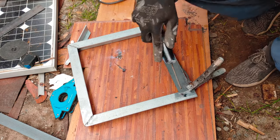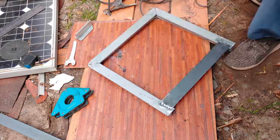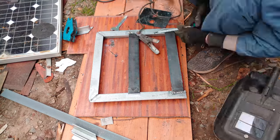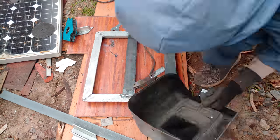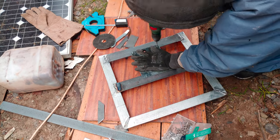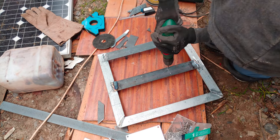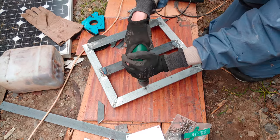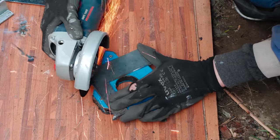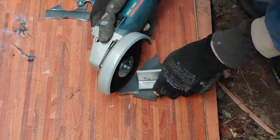Next I'm welding in one of the two trusses where the diesel heaters are gonna sit later on. And yes, I said heaters with an S. In fact, I'm building a structure which allows to mount two diesel heaters. Next I drill the holes for the platform that comes with the diesel heater. Here I'm making two supportive brackets which will be welded on in a 45-degree angle.